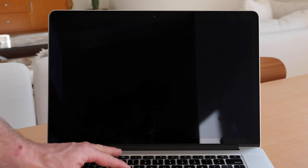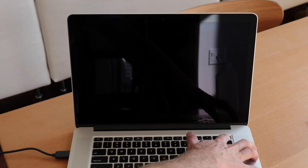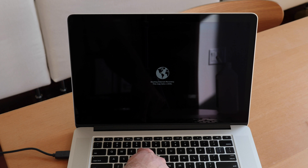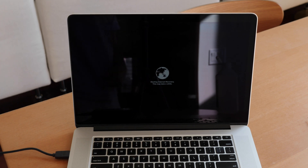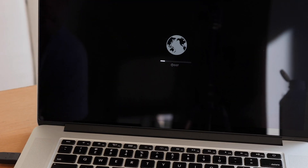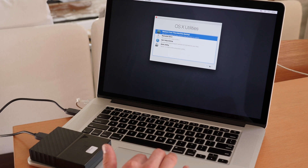What you need to do is boot up the Mac in recovery mode. I plugged in my hard drive with my Time Machine backup and pressed the power button while holding down Command-R. The Mac boots and uses the internet to download a temporary system in order to install a new OS or do whatever you need. That'll take 5, 10, or 15 minutes. Once finished, you can navigate to your Time Machine backup, and it will recover the entire thing and clone it onto your new hard drive.